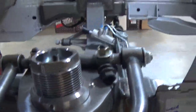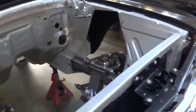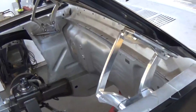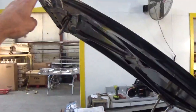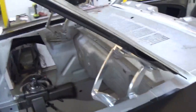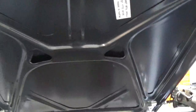Mustang 2, you'll see, again, all the nice professional welds. This is essentially what you need to start with. Hinges, for instance, the billet hinges, definitely a good idea. It allows this hood to close much more easily, smooth, comes up on its own. What you'll notice is if you use a standard one with a big spring, as the other car didn't have on there, and or fiberglass hoods, metal hoods, they'll tend to bend here. So as you're pulling way out here, they want to bend. You can already see this one wants to a little bit, but when we got a big old hefty spring there, it bends the hood. Fiberglass is even worse because it'll start cracking on the outside. So the $600 hinge is well worth your money. Not only does it style up the engine bay, but it helps your fit, finish, and final product.